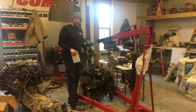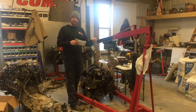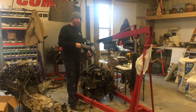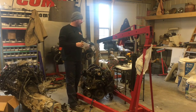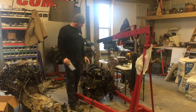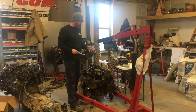The goal for today is to get the slip yoke mounted. To do that, I've got to RTV the bolt that goes in the back to keep oil from coming out. We're going to work on some wiring, make sure I get the connectors good and set on their spots in the harness. We've got to work on the transmission plug wiring, because when you swap from a 4L60 — which was what was in the Tahoe — to a 4L80, you've got to add an extra vehicle speed sensor, but you've also got to rewire some of the connector that goes into the 4L80 so it sends the right information to the computer. Todd and Blake at LSX Harness did our reprogram of the computer, so it runs with the 5.3 and the 4L80 setup. I've only got about three and a half hours, so we better get started.